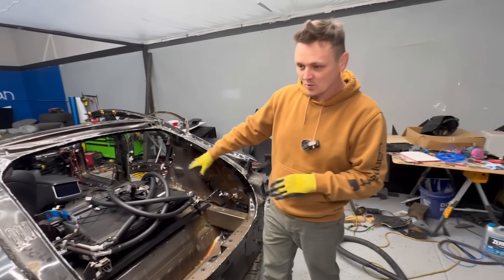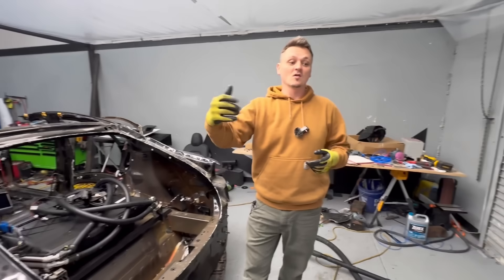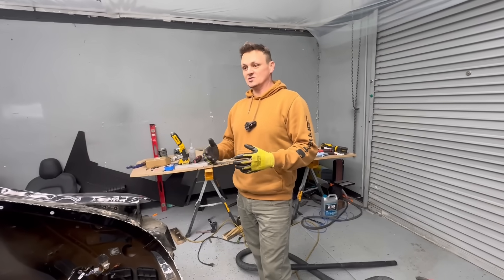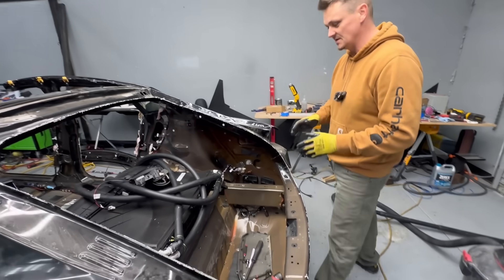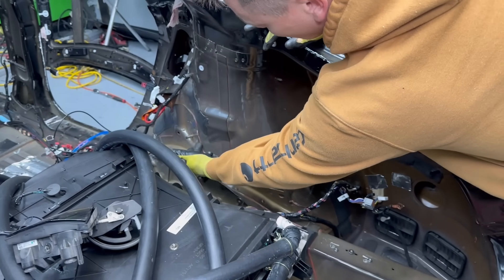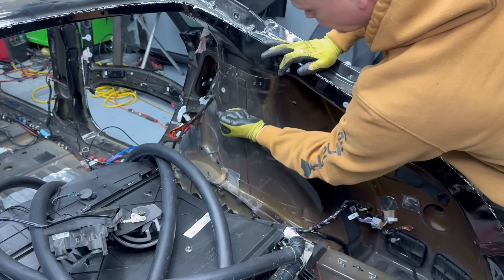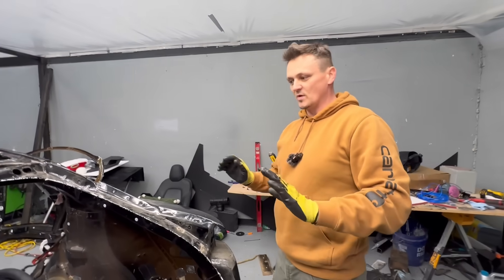All right, so this is the fun part. I moved the car forward because I'm going to be working on the Cyber Roadster and need to drive that car out pretty soon. Basically I'm just going to go to town and start cutting. What I need to do is completely take the strut towers off — all of this needs to come off because these struts are going to be cantilevered and they're way too high.